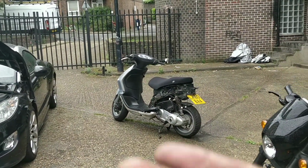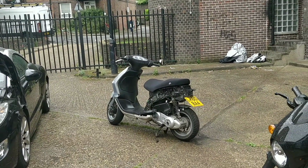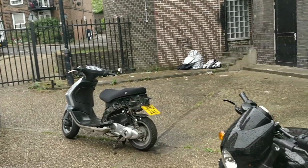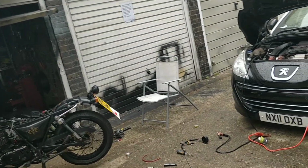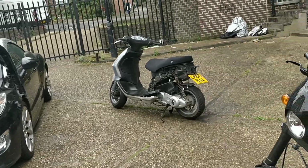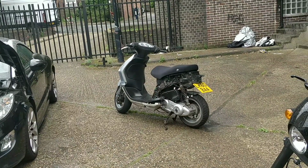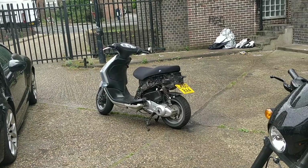but this is the reality when you're doing these kinds of things. All I need to feel for now is that that bike does full power and hits 30-40 in a reasonable amount of time. Once that's achieved with any carb or setup, then we know to dig deeper into the actual Piaggio carb, even if we buy a brand new one at 120 quid, or just kind of work on that one, which I'm going to have a little look at later. So I'm going to pop that airbox off, suck some fuel through, make sure that's all good, and try again